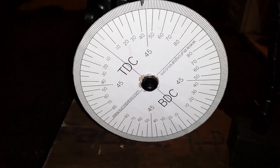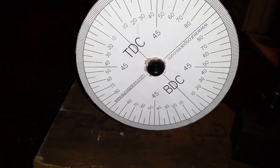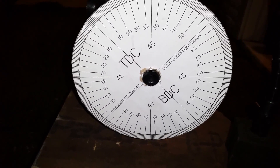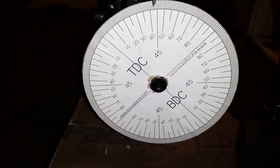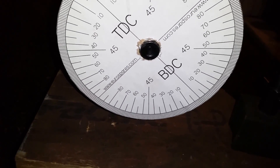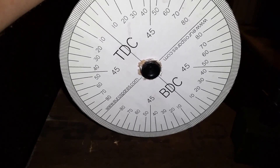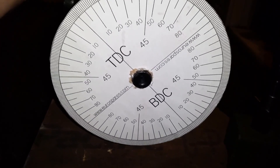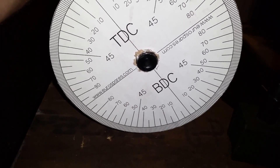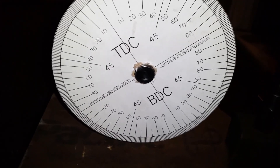So this has — actually 43 and a half degrees — almost 90 degrees total travel, which is way too much for an F-body. But if you do the math, using somewhere between 3.05 and 3.1 turns, and that's pretty accurate — 87 degrees of travel — I get between 12.62 and 12.7 something ratio, which is actually the fast ratio box.